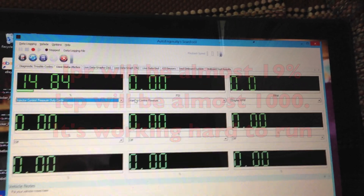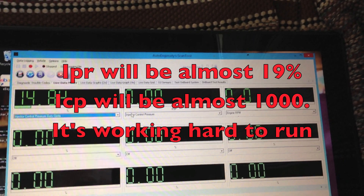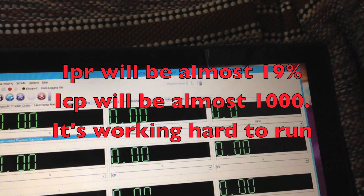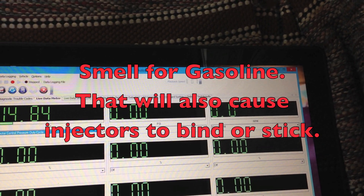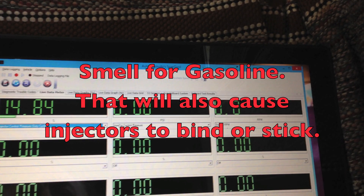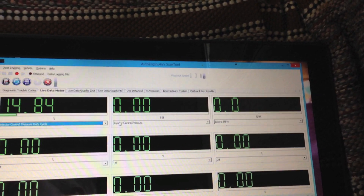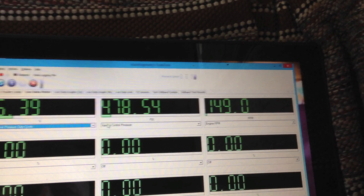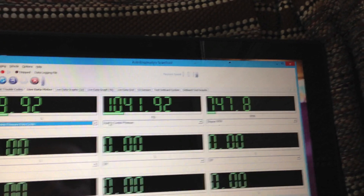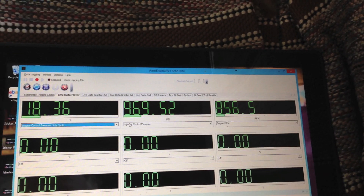This is going to be the startup. Notice just the top three feeds because that's the only ones I have going. I'm going to go ahead and turn the key on, wait for the glow plug light to go out. We'll start cranking it and see how long the ICP pressure takes to build—we want to see it above 500—how hard the IPR valve works, and the RPM to make sure the data stays live. So we started up, pressure came up.